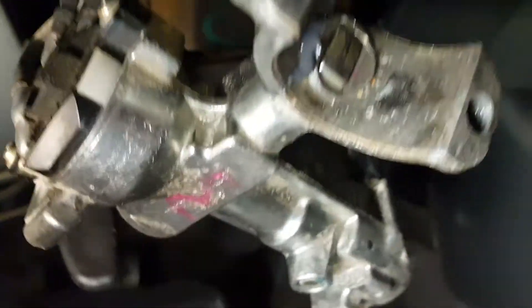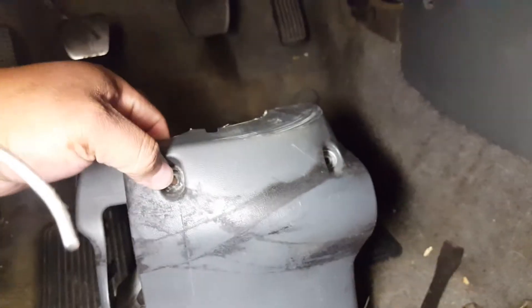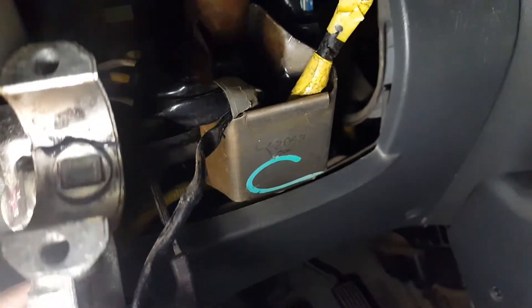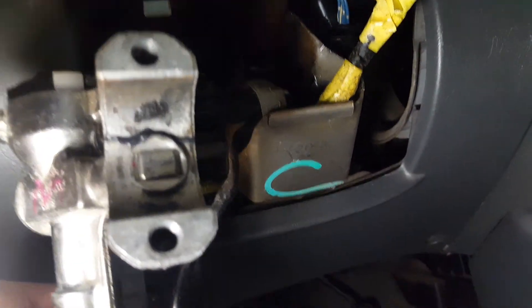This is the bottom of your steering column cover, and that's where the cylinder goes. You basically just need to take off these screws — they kind of ripped and screwed them up, but I can still reuse mine. Here's the main point for this video: when your steering column is twisted, your steering wheel will never get straight. This is the problem right here.